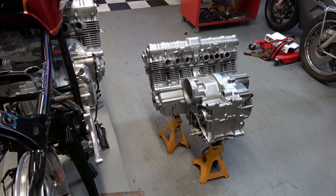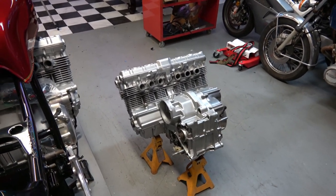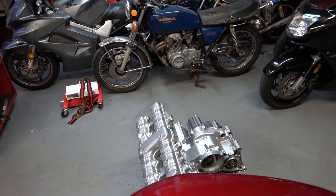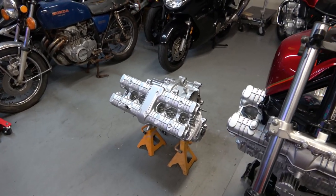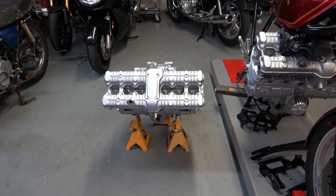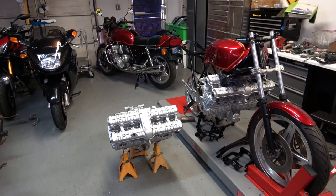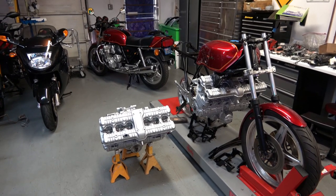Because I only have one lift, without the advantage of having the lift you can also attach the frame to the engine if you just have the engine on the jack stands — the frame goes back on the engine very easily. I have the third one there just to stabilize the back of the engine so that the weight of the frame doesn't push the back of the engine down.